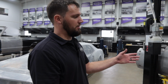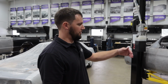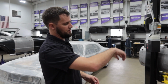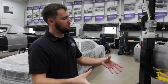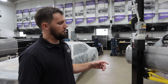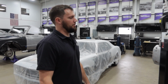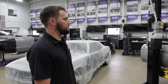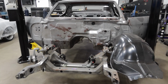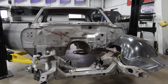Yeah, it's kind of time consuming because it's a lot of in and out with the motor and transmission. Right, kind of testing it, making sure it fits, and seeing where you need to adjust. Yep, so you cut your initial hole, have the motor and transmission in, do your initial bell housing piece, shaping, get that tacked into place, and then you move on and basically work in sections all the way back, constantly checking your clearance, your driveline angle, and then of course building your crossmember and everything like that. So it's a lot of back and forth, but it's what it takes to make sure you have the appropriate clearance around the transmission. And then once that gets done, more than likely we move on to fitting front sheet metal, hood, grill, everything like that, and start gapping stuff. So this is moving along at a good steady pace.